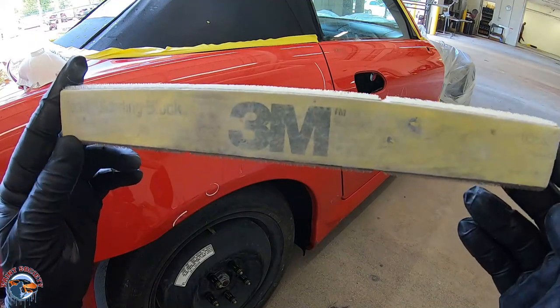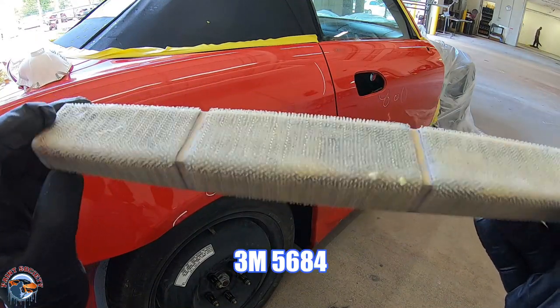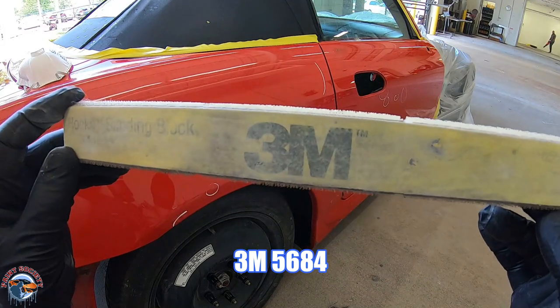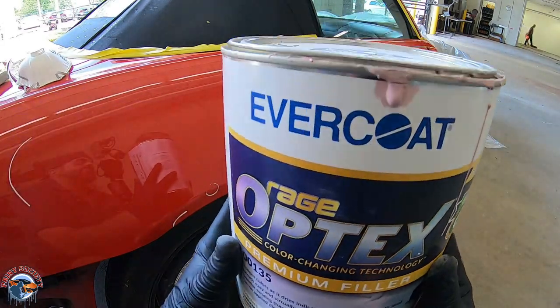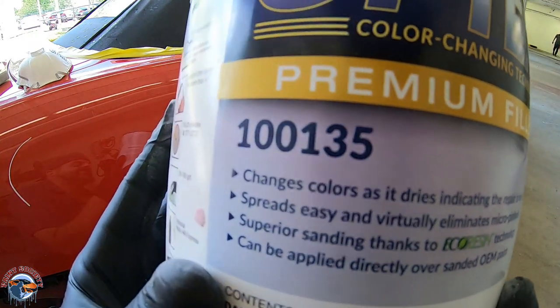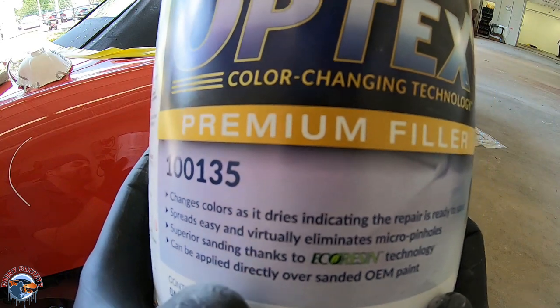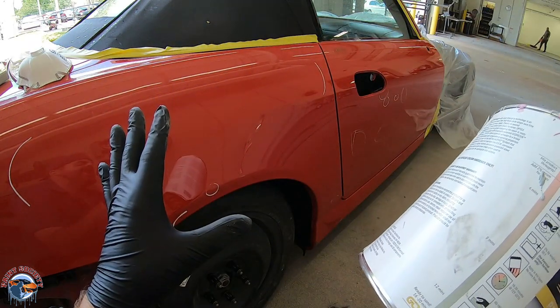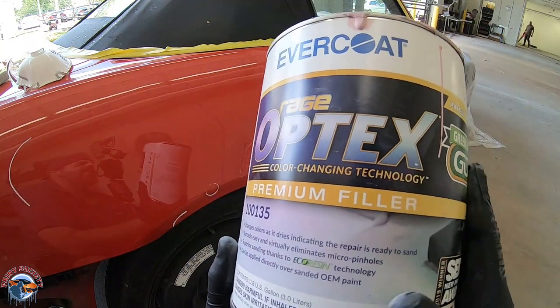Now we're going to be using a 3M block. It is hook-it, that means it's Velcro. I love this block. I will put them in the description. Next up, we're going to be using Evercoat Optex. And here's what I love about this. It says it can be applied directly over sanded OEM paint. Well, this is OEM paint, and we can directly apply it once we scuff it up. What do I mean by scuffing it up? We want at least a 180 grit sand scratch.